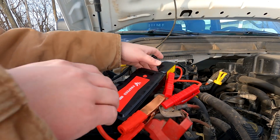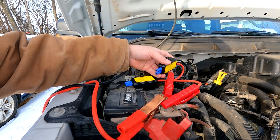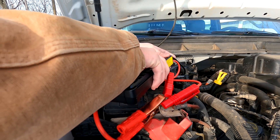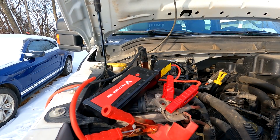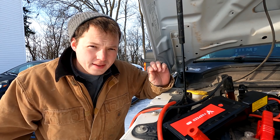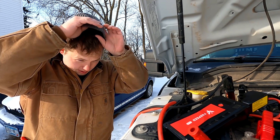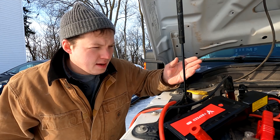I think something with the jumper pack being really cold, or the fact that it's only at 70%, made the difference. I'm just really surprised it started at all. Let's try one more thing — let's take the lawnmower battery off and try starting it without any external battery connected. You can see that it did start the truck with no external battery connected, but it didn't stay running — the relay was clicking in and out inside the jumper. So it won't work to run the truck exclusively, but it did start it.